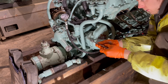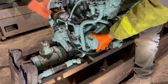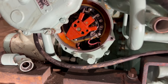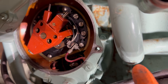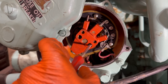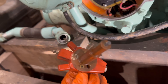The next step is to remove the distributor caps and take out the rotor arm. I then use a cable tie to hold the cap out of the way while I remove the rotor arm. There you can now see the rotor arm — this is the in-mag. It's actually in really, really good condition in there. I'm quite shocked actually. But I need to take this off to gain access to the points behind. These rotor arms are extremely fragile, so I have to be really careful with these.